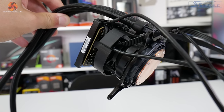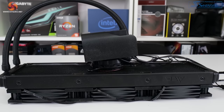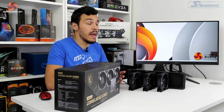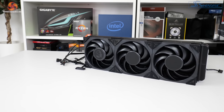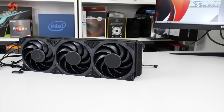However, it's a relatively small 60mm blower and has significant airflow restrictions above from the screen and below from the pump block unit. So we'll have to wait and see how useful it actually is in our motherboard VRM testing segment. MSI's choice of fans are a trio of Meg Silent Gale P12, which are intended for noise-efficient performance according to MSI.